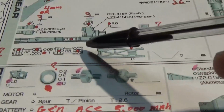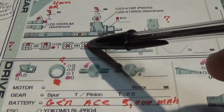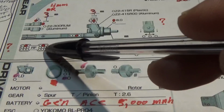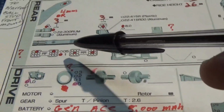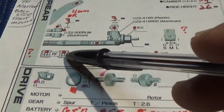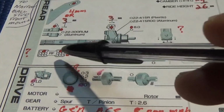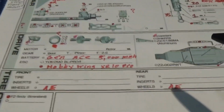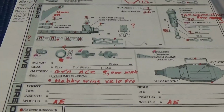Okay, another thing I did was I went center on my hinge pins on the pills. I kept the hinge pin center on the back and center on the front. I didn't get the chance to test this. This is what I'll be working with next time, is pills. I should have on the front moved it up 1. We just went straight up on the front pill, the anti-squat and stuff like that, to play with that stuff. See how it feels.